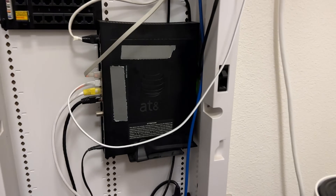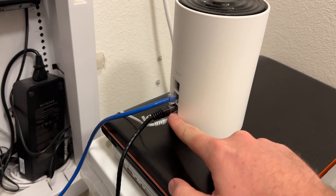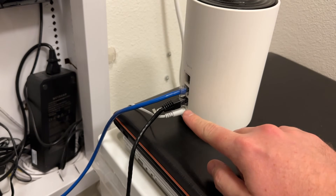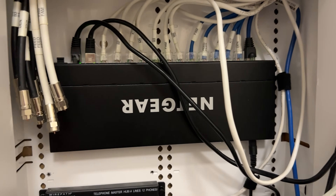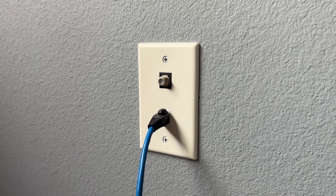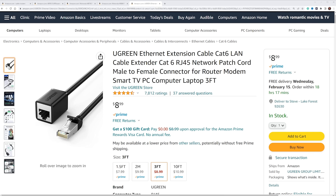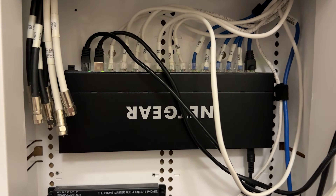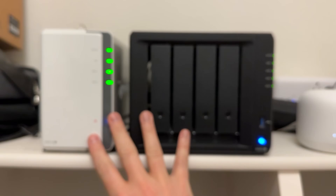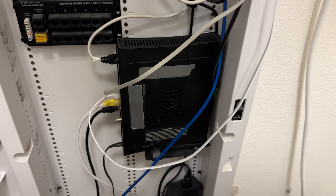Here is the real world setup. You can see the modem right here. This black cable is plugged into the back of the modem, and the other end is going to the back of my router right here. We are now getting Wi-Fi. Now I've got another cable coming out — this is the blue cable right here. Following it up, this is actually going into my 16-port switch, plugged into port number one. The rest of these cables right here are all running to the different rooms of my house, so in each room there is a port that I can now branch off of. If your cables aren't long enough, you can get cable extensions. I've also got two black cables extended up that are plugged into my network storage — those are plugged into the switch, which is plugged into the router, which is going out to the internet.